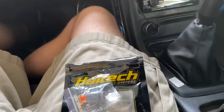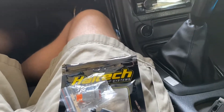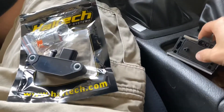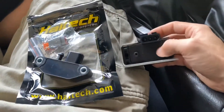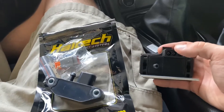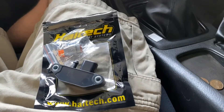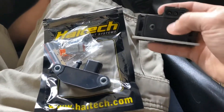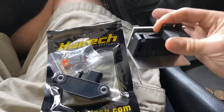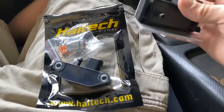It would start and instantly stop, and it was really odd. I couldn't quite figure out what was going on, but sometimes it would start and act fine. I eventually got it to start, act fine, got down the road and got home, but the problem continued intermittently for months — probably six or seven months. Sometimes it wouldn't start right, and sometimes it would start acting up while you were driving. You'd just be driving and all of a sudden the thing would go really stupid lean, lose power. You'd give it gas, it would go so lean it would stop running basically, which was really dangerous.